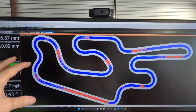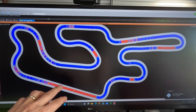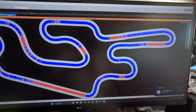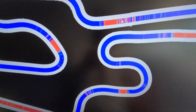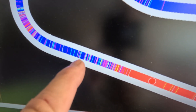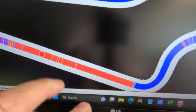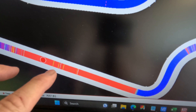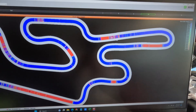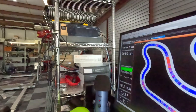Last one I'll show you — this is a track map. But it's actually using front ride height as a visual. You can see when it changes different colors. Going down a straightaway, it gets closer and closer — a little orange, orange, red, red, red. So it's bottoming here, it's touching the track. And then blue, of course, is not. And there's a legend here. You could change this, of course. But that gives you an idea of how I use the Izzy laser sensor.